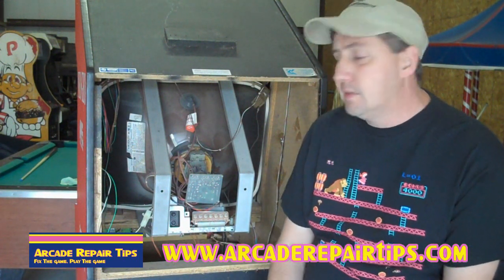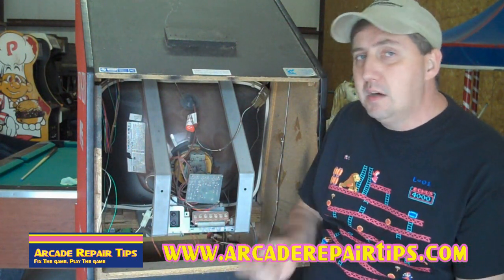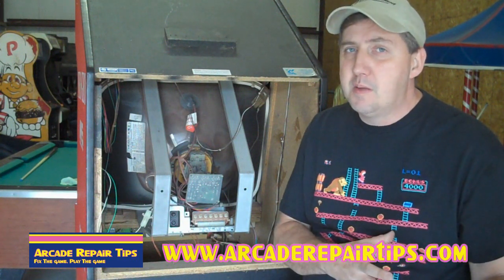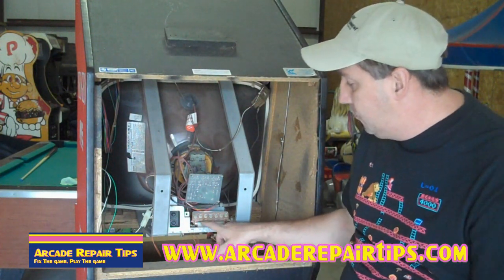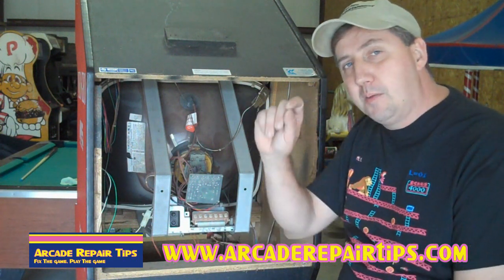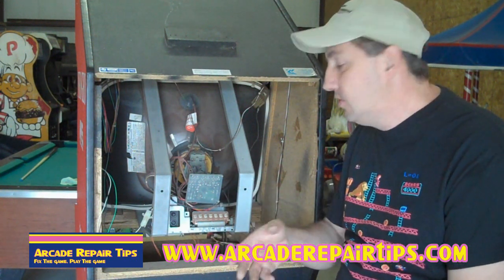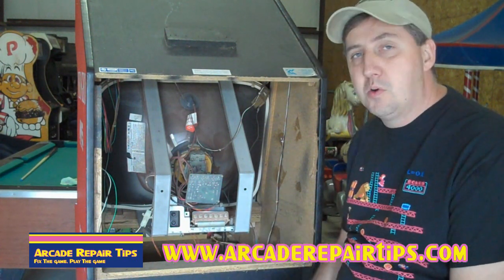Don't be afraid. A mirror or a good friend with a good eye for this stuff helps. I've been by myself and just had to run back and forth and turn a little bit at a time. One last tip: if you don't want to mess up something or experiment too much, before you start, take a black magic marker and mark where you started. Mark one side of the pot and mark your board, and then you'll know where to go back to if that adjustment doesn't help. Or if you get it like you like it, mark all of them where they are.